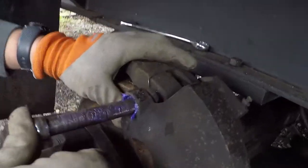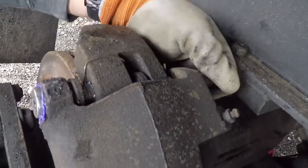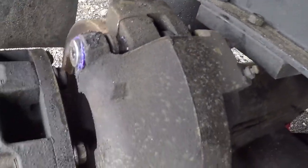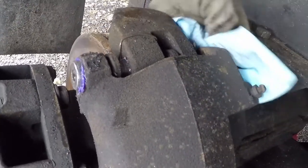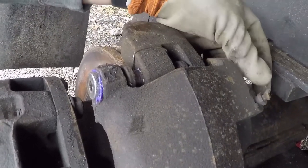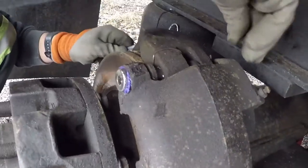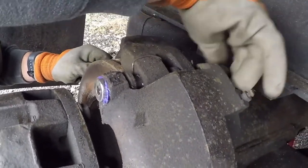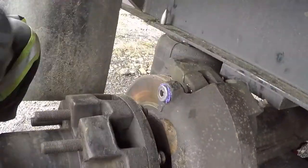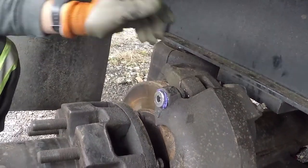So it's not something to get seized. And just like that — without the bullet, it is nowhere near that easy. You have to use a pocket screwdriver, a flashlight, and a bunch of cuss words. Then put your nut back on the back and cinch it down with an impact — not super tight, but it just speeds up the process.